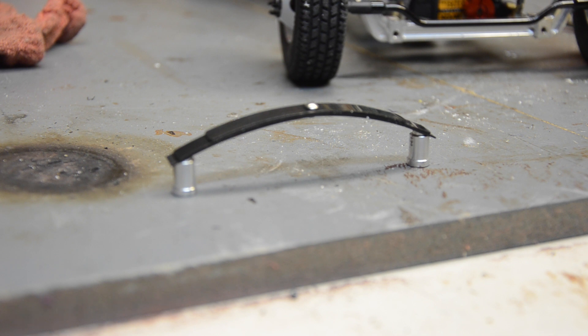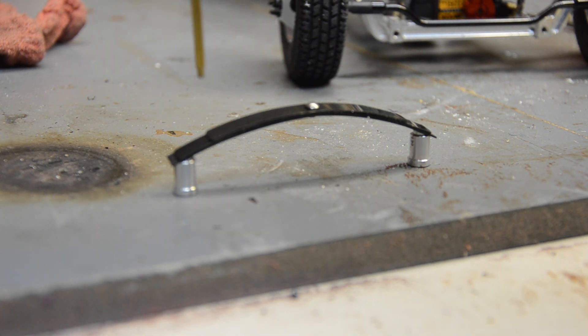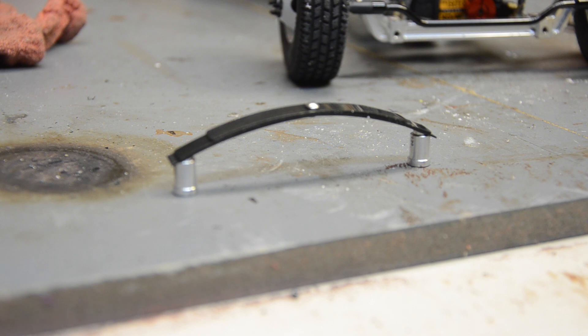They weren't going to work so they were sitting here. I cut them down at an angle and I'm going to mount my leaf spring to that through the axle. I'm going to have a bolt come up through the leaf spring. Now the trick is - and it's going to be a trick to do - the top of the leaf spring I'm going to cut a groove, not a hole, basically a slit, so that it can move back and forth two or three millimeters on the bolt that's bolted through the axle. And I'm going to have to shorten the leaf springs a little bit just to fit between the axle drop ends, so it has room to move in and out from the sides and not bind up. So this is going to be a delicate balance of eyeball engineering.